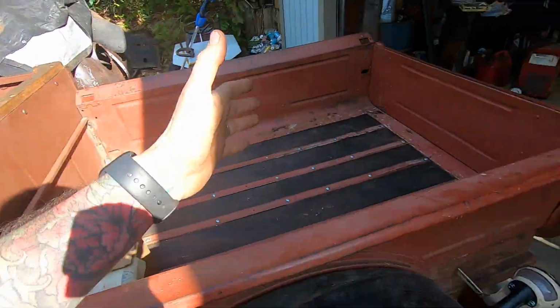Put all the fluids in. First drive, I didn't actually have any fluid in the transmission. Whoops. It had oil on it from assembly, and that probably saved it. Everything's fine in there. So I added transmission fluid, and I actually took fluid out of the rear end, topped it off with new stuff. Yeah, radiator's filled to the top. That's good, it's all burped out.